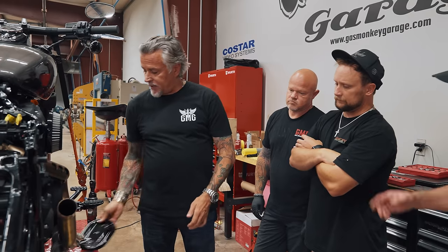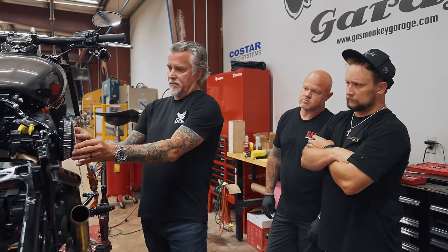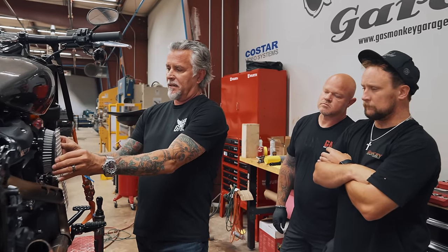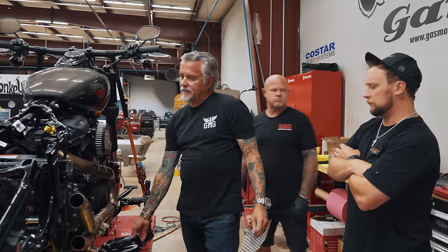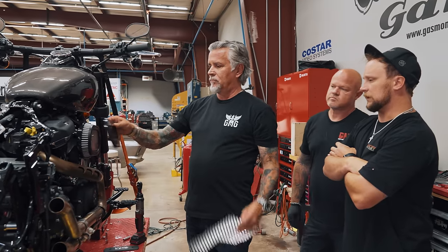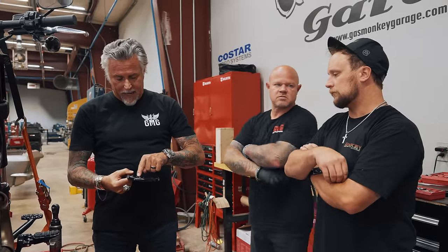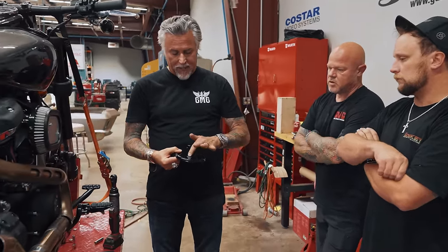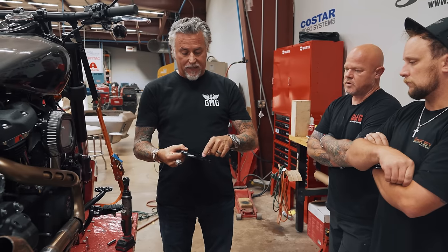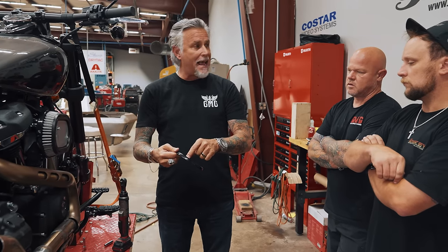Okay. And put the mesh in there, paint this gray, the Harley orange, space the mesh off a little bit so it gives you some depth, and then put this back on. So sandwich the mesh in between the cover and the filter. I think we come in like that. You can see my greasy finger, real sexy. And leave those two little bolt holes and then cut everything else out all the way around this line. You got these two sexy tabs.